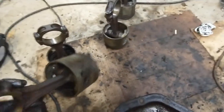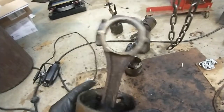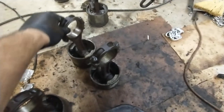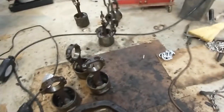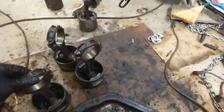Look at this — that's a bearing in there, but as most of us know, that connecting rod should be moving. Every single one of them is completely locked up. This engine would not move for me at all. I had to loosen the crank, loosen all the connecting rods, hammer out the pistons I could, and work the crank around. Finally got it all apart. Make sure you're careful if you have to use force — you don't want to break anything. These pistons I don't care about since I know they're shot, but they're aluminum and they can break. All of them are just seized.